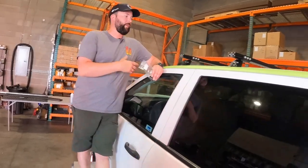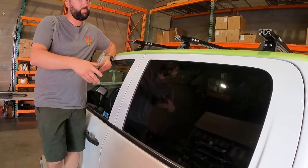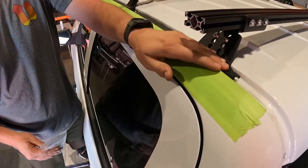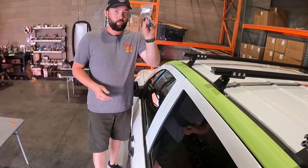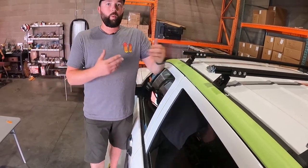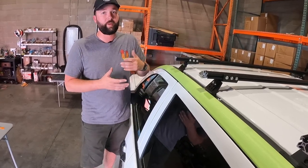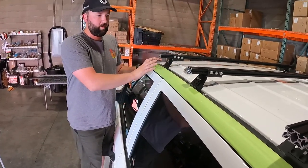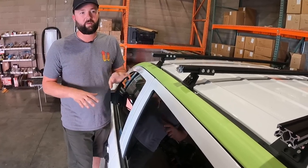All three load bars are set up in their approximate locations. For the rear load bar — the one above the seam of the back door — push that foot so it touches the rivet; that's your locator there. Do it on the other side as well, and leave the middle one floating. From the load bar bag, you'll be using one-inch button head bolts with lock washers. We're going to hang the Bravo sides next: they can go either driver or passenger since they're not side specific. Loosely hang one side, then hang the opposite side for balance, and then we'll talk about location.